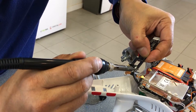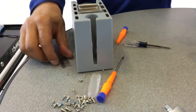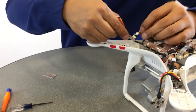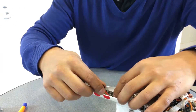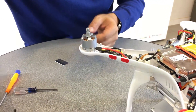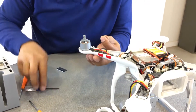All right, so now we've got this done. Use a razor blade just to make sure these wires are not touching — and they're not, they're physically separated. Let's go ahead and put this back into place. Put the larger control board cable back on. Now let's go ahead and put the motor back into place. Put the screwdriver back and use the small screws here that hold the ECU to the logic board.